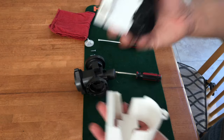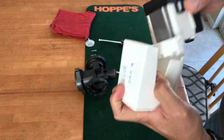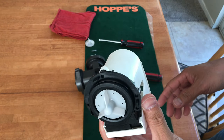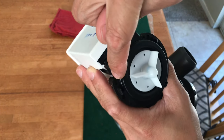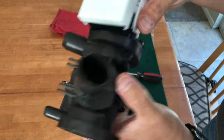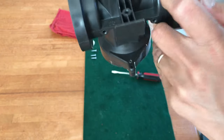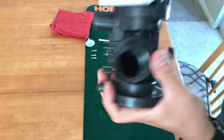There's the old one. Next, put the new pump into the plastic housing — it snapped in easily. Connect this to the drain pump housing. For orientation, you need to put screws right here, right here, and at the bottom. Just like that — press it down.